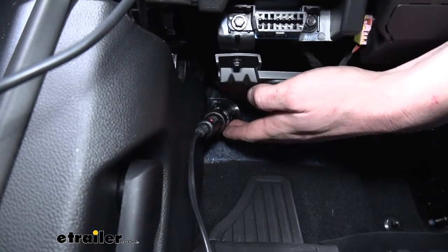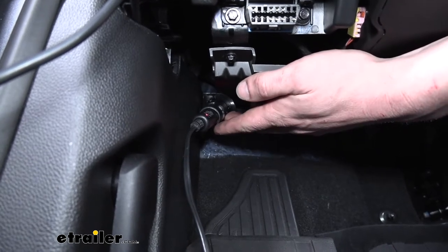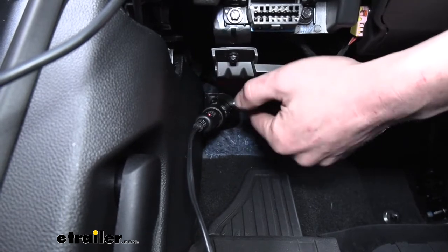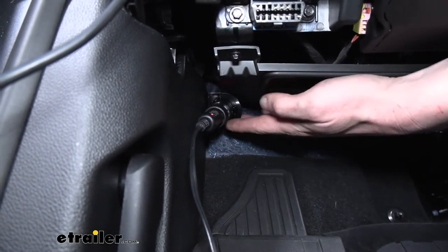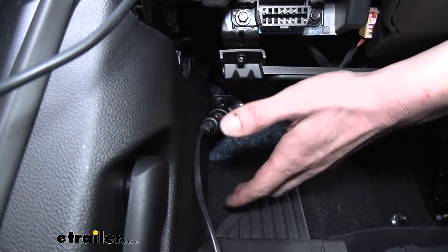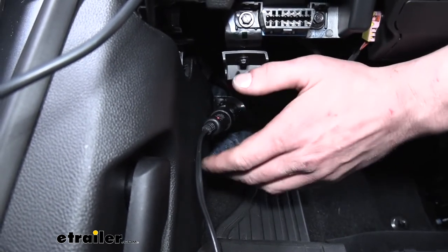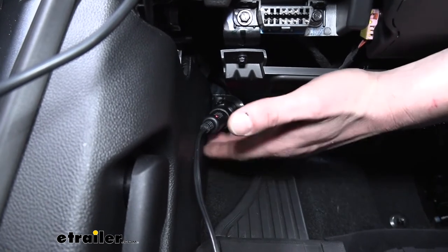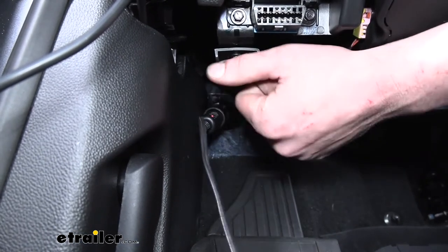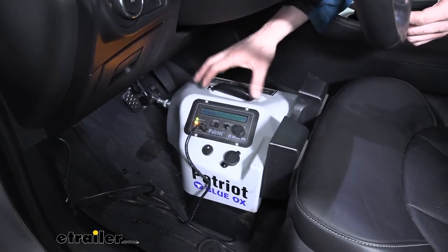Here's where I found is the most suitable location to hide the outlet, but still be easily accessible to plug in your braking system. We're on the lower left kick panel area, up as high as we possibly can to the lower panel underneath the dash. We put a slight angle to it so we can easily plug in and out, but it keeps it out of the way when we're driving. You can see our 12-volt outlet in operation — it's powering up our braking system here.